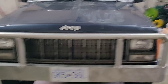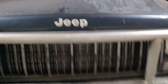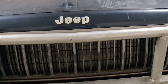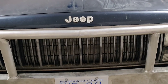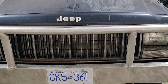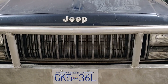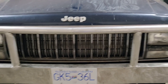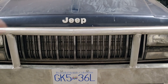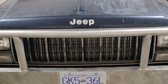You'll see there's sort of a grill on the front here, but there's not actually a radiator or anything — there's just a flat aluminum plate that I've mounted a whole bunch of stuff to. I might add some cooling in here. It's sometimes recommended to do a bit of water cooling for the controller as it can get a little warm. I work in Canada so it's not amazingly warm, but in the summer it might cause a few difficulties. I'll do some tests to see what my temperatures look like once I figure out what gears to drive in and what RPM range the motor likes. I can always put some cooling back in — it won't be a huge radiator, maybe just a chill plate with a couple of tubes running.